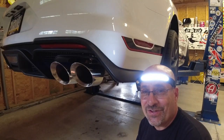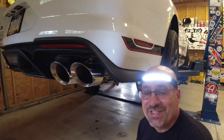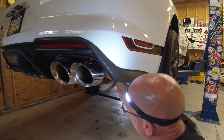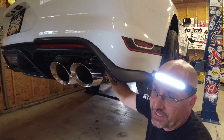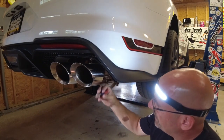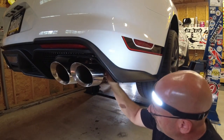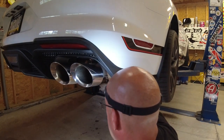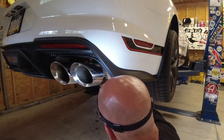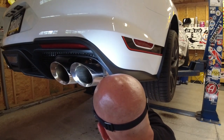This time I haven't messed with this exhaust system at all. Now I could take this into a Ford warranty shop and have them mess around with it, but since I know the problem I know how to fix it. This is located right up here and if you reach up in here you'll be able to feel a connector. I use a little stubby screwdriver to pop this connector off — there she goes — and then I can pull this harness out.